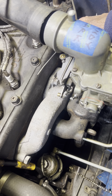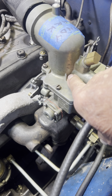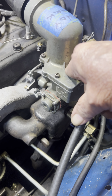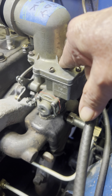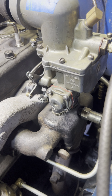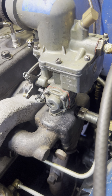I found some problems inside. The low speed jet was too small; I made it the correct size — a number 70 drill. The metering rod jet had too many threads, so it was bottoming out too soon, which created issues with the metering rod.